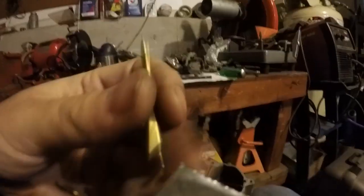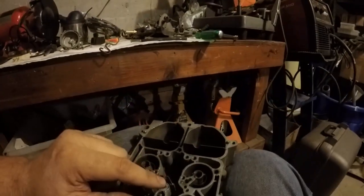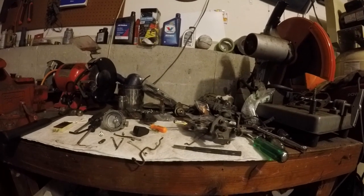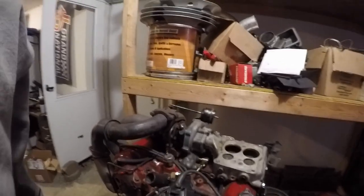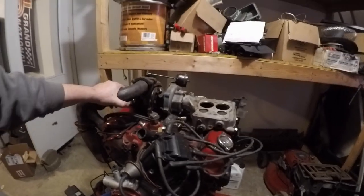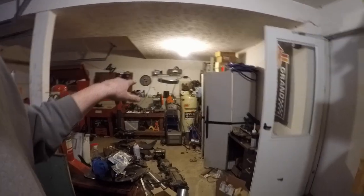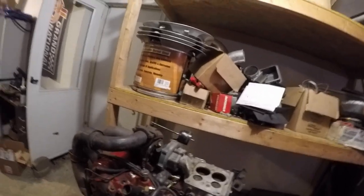That's how turbo cars are supposed to be — it's not too hard. A little JB Weld, a check valve, a different spring, and different metering rods, and this thing should be set up to run pretty good. This motor's pretty cool — it's the first year of the Buick turbo V6. You could get it with a two-barrel or four-barrel; this is the two-barrel part but I went ahead and upgraded to a four-barrel. I can actually run it here in the garage — I just gotta dip this in a gas tank and give some power to my distributor and fire it up. I'm gonna go ahead and finish this carburetor and I'll show you guys more about this motor in an upcoming video. Thanks for watching and have a great day!